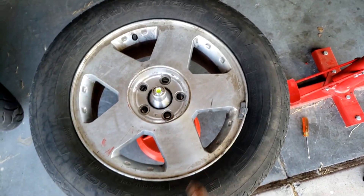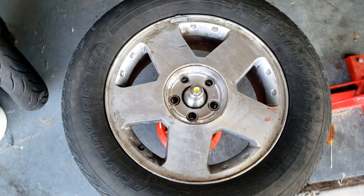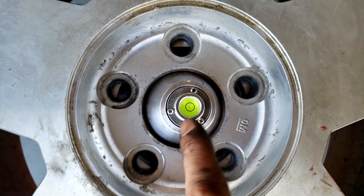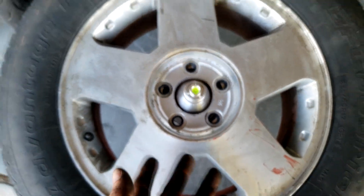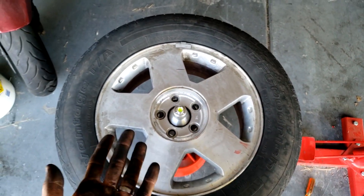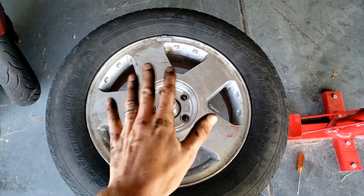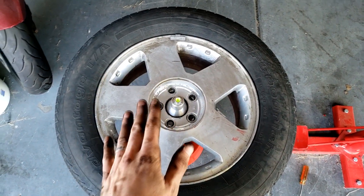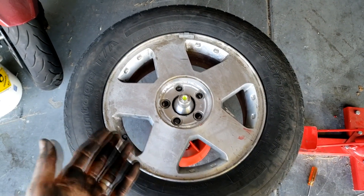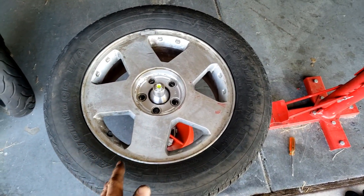Try it over here and over here just to make sure. You can see the V is over here this time and the bubble is still pointing towards the V. If people say this doesn't work, then how does it confirm this four times? It is pretty obvious. As long as it's greased up and free to move, you can rotate it and triple-confirm where the weight needs to be applied. The system works pretty well — it's just about setting it up and understanding it.